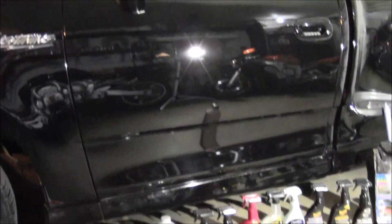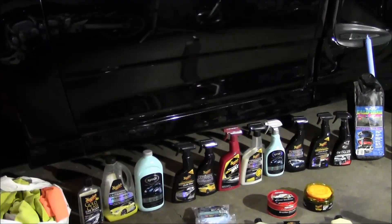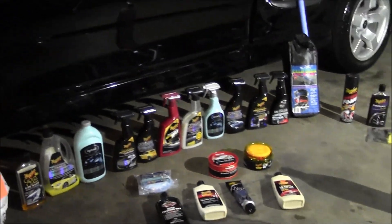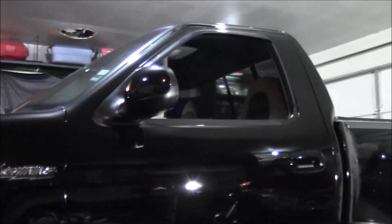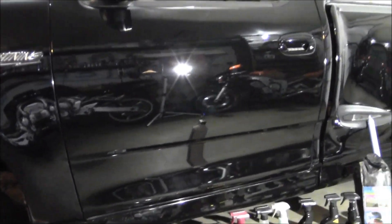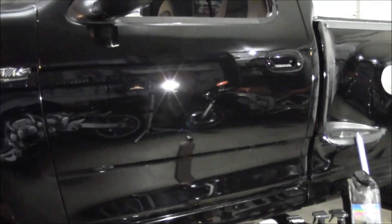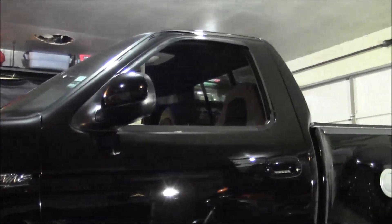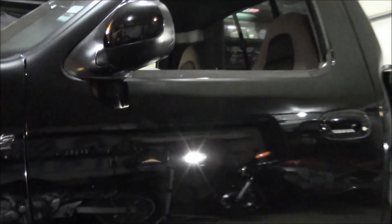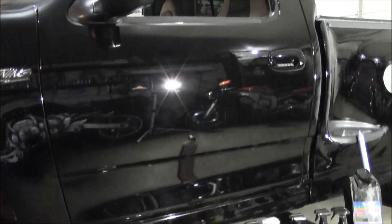Another consideration: you might actually have to mask off the textured plastic with masking tape before you put wax on it. That's another advantage for the spray wax. You could also combo it up — maybe you want to use a paste wax but don't want to mask everything off. Go ahead and paste wax where there's no textured plastic, and for the tops of doors just use the spray wax. The spray wax is also good on rubber and trim around the door — it's definitely not a bad idea to get some kind of wax on those parts of the vehicle as well.